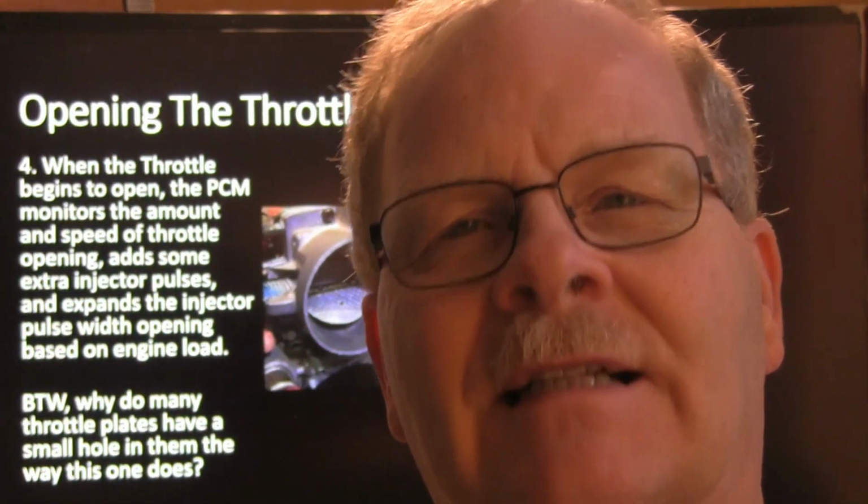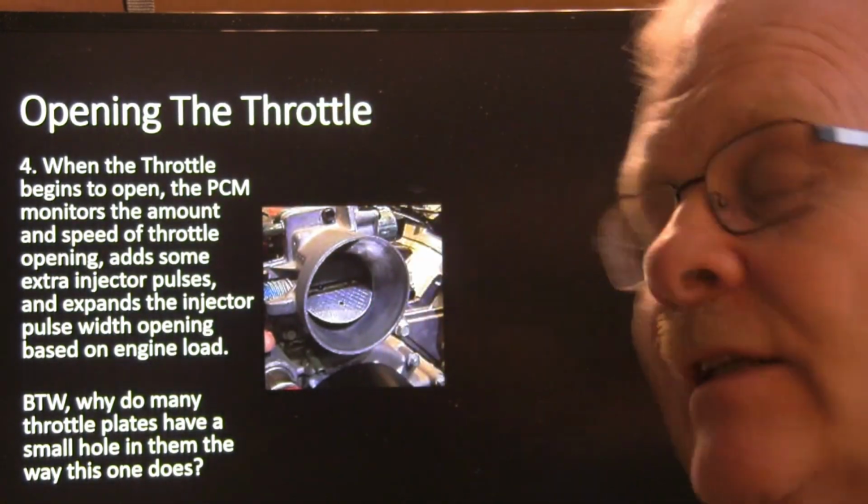Anyway, I was noticing that it would instantaneously catch stuff that you won't get on serial data. You'd have to have a scope to see it. On these fuel injectors, it would give you a little square wave showing you when the fuel injectors were clicking. And I noticed when you would crack the throttle, you'd get a bunch of extra pulses on the fuel injectors, which basically takes the place of what the accelerator pump was doing on the old carburetors. That's what the deal was on that.